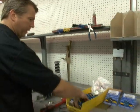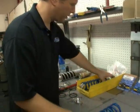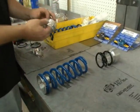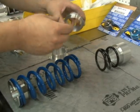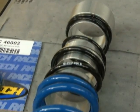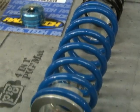This is a spring kit for the YFZ450. This will be a triple-rate, zero-preload setup, which is what we call a race series. Race series doesn't really refer to whether or not you race — it's just terminology. We separate the two: race series being a no-preload setup and sport series being a preloaded setup.